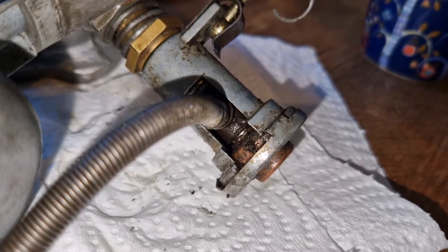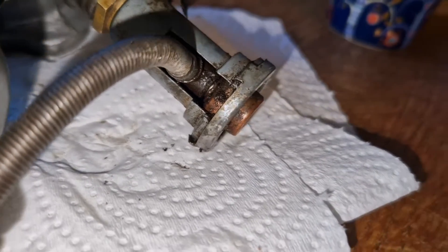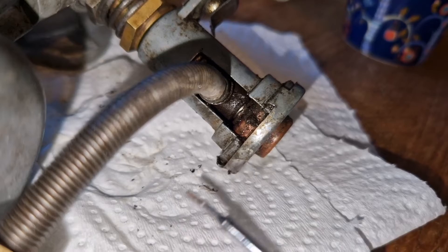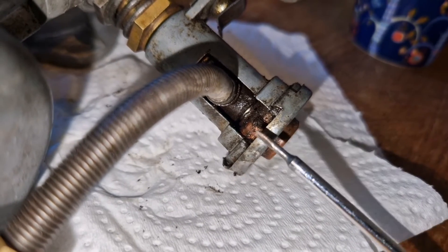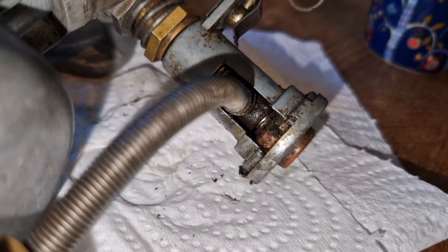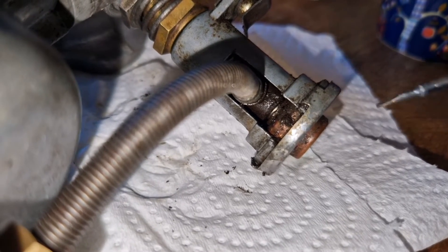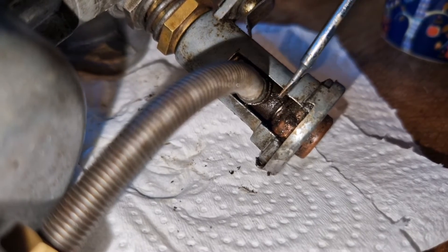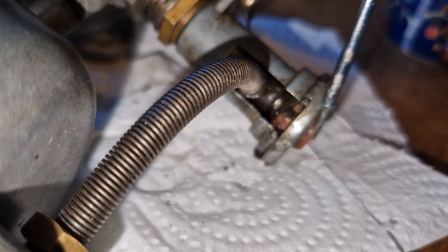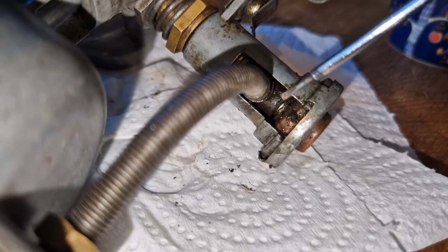As that leaning-out is for emissions, I don't think it's going to matter, and apparently it actually robs a little bit of power anyway. So I'm going to pull back these three tabs — which is not for the faint-hearted, it's very difficult. This will remove the bottom casing so we can get the wax stat out and have a look inside. I suspect it will be empty. Then we can replace it with the two 1p coins. I need to keep that little silver pin. I'll measure this gap again after we make the change.